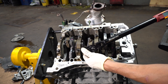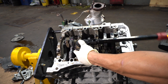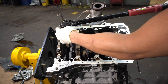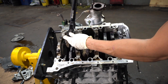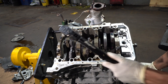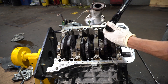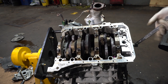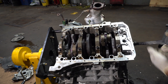Here is the degreeing we're doing — the connecting rod bolts are 90 degrees. The main cap bolts are like 47 degrees or so — I'd have to re-check the repair manual. Anyway, we're winding down to final assembly, at which point we'll be able to reinstall it back in the car. Even though this video is about 20 minutes long, keep in mind it did not take me 20 minutes to do this — I have about three hours of footage until my battery died.